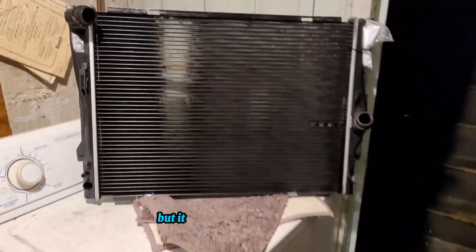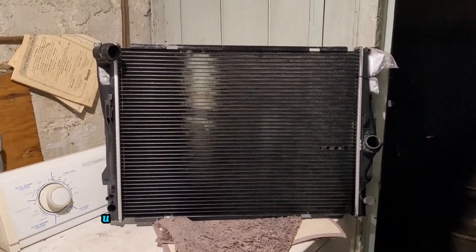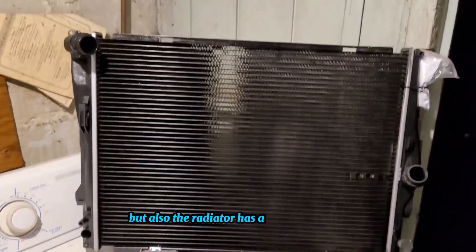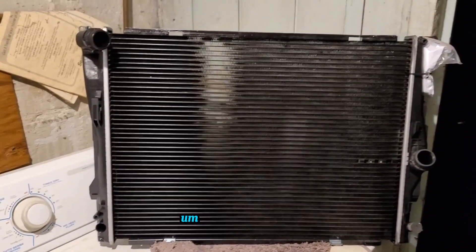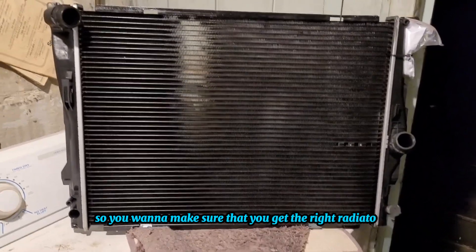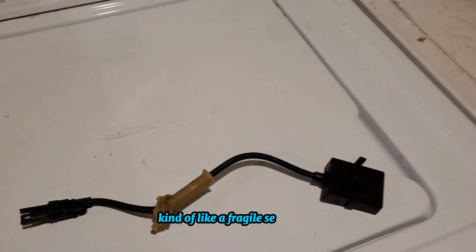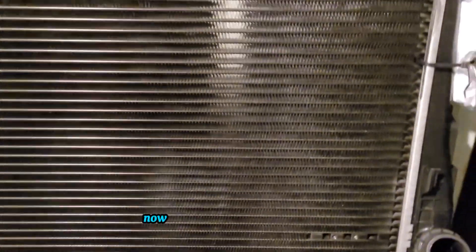It's not just the radiator port that matters — the SULEV radiator also has a specific special coating. If your sensor goes bad or you don't put the right radiator on, it won't read correctly and you'll get a check engine light. It's one of those codes that will actually cause your car to fail a state inspection. So you want to make sure you get the right radiator and that your sensor is working. This sensor reads the air going through the radiator and actually reads the radiator itself.